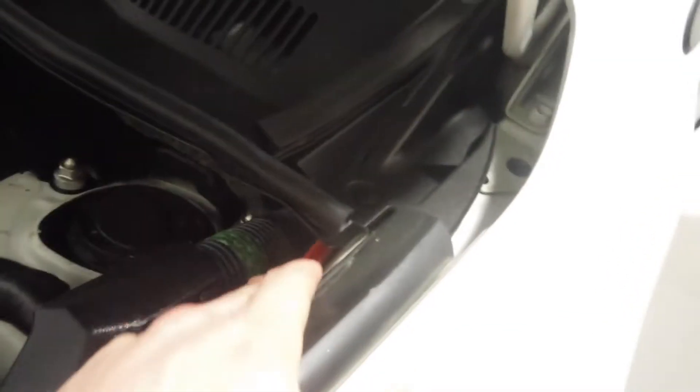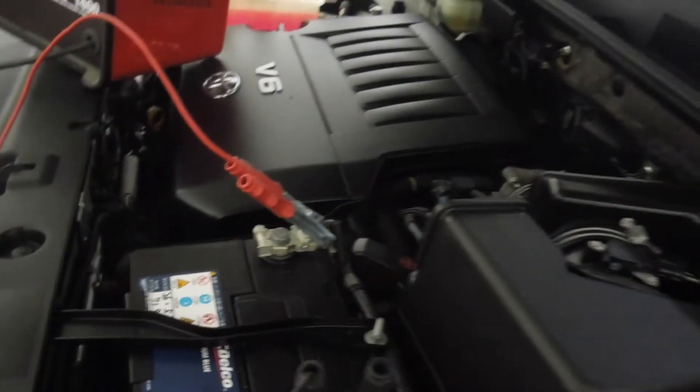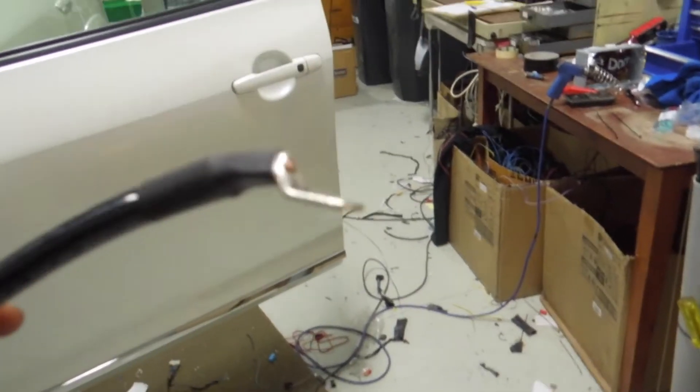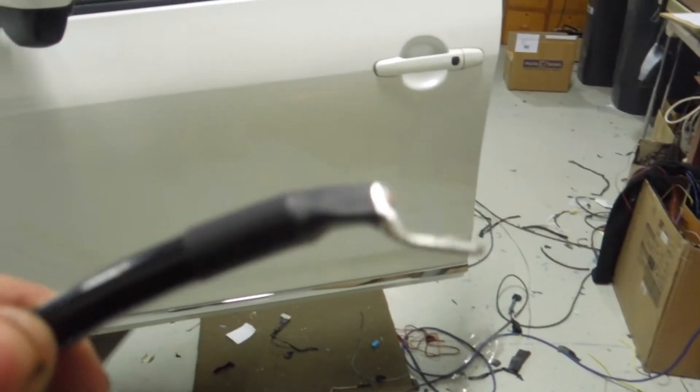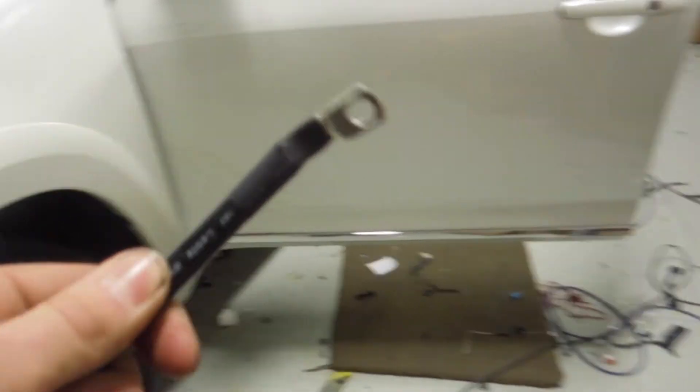The power wire is now inside the car. This end is going to run along with the main loom down the side — I'll tuck it around and figure out what's going to look best. There'll be a fuse holder mounted somewhere before it goes to the positive terminal. Here's my ground loom made up — a nice piece of four-gauge wire, crimped and heat-shrunk with the big crimpers for these great big crimps, heat shrunk to make it look good. Done the same for the positive end.